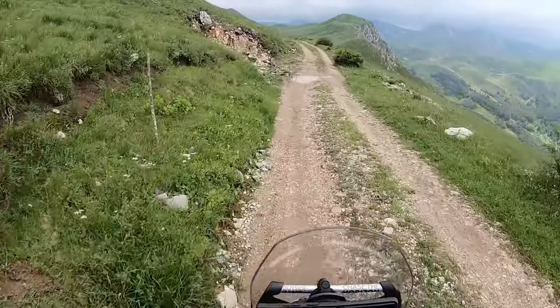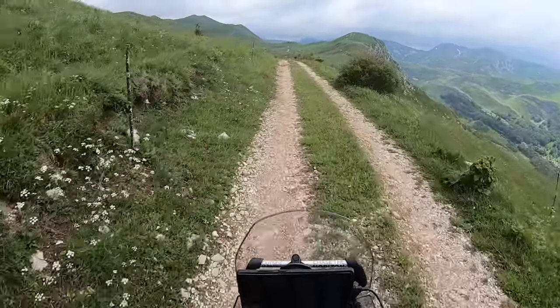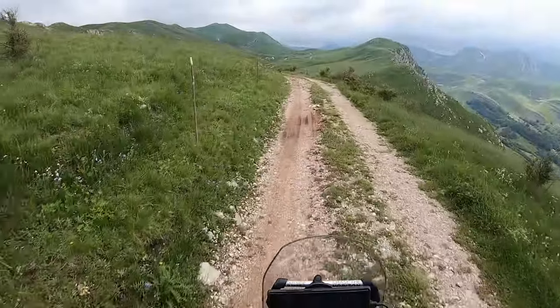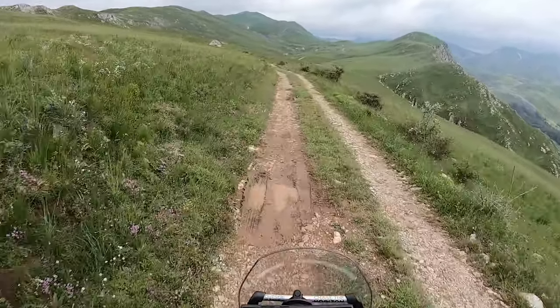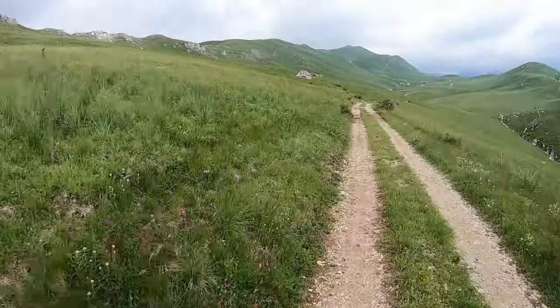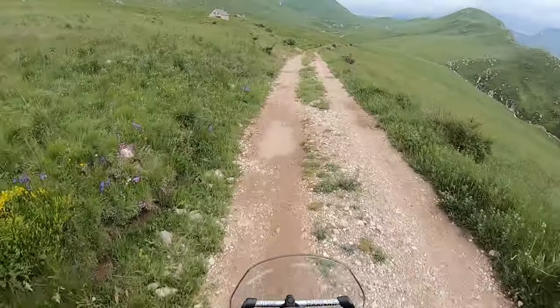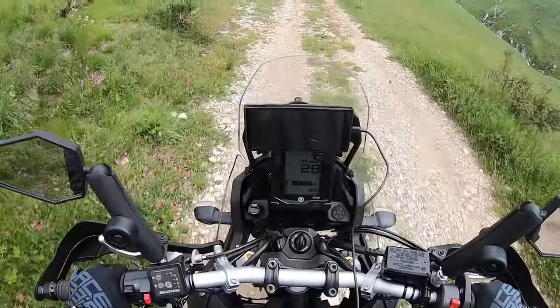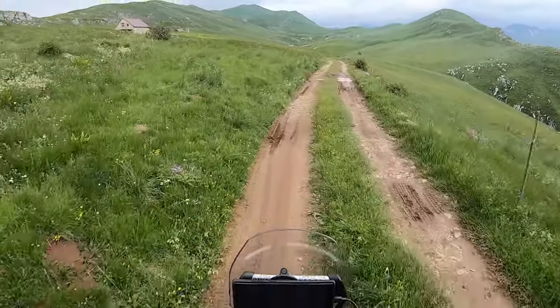It will feel like you're riding on wood, not on rubber. Yes, you can decrease the pressure, but you need to decrease the pressure in a rear tire extremely. And then you will shorten the lifespan of the tire even more. You will gain 10 or 15% more performance in off-road, but that's it. I wasn't that fascinated with E10, to be honest.